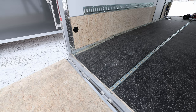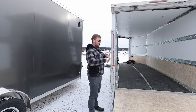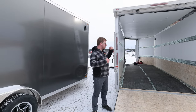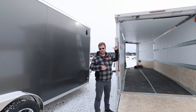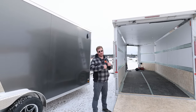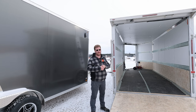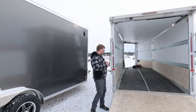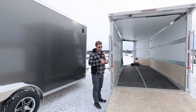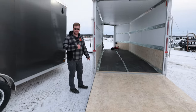I've done a no-show beaver tail — a 48-inch no-show beaver tail, so it's bringing that peak four feet inside the trailer, which is great for my side-by-side to give me extra height. This is a seven-foot tall, 84-inch trailer, and what that beaver tail does is instead of losing the three inches of header and having an 81-inch opening on the door, I now have 84 inches true on the door — 84 on the door opening and 84 inside to load what I need. Upgraded the frame and upgraded the ramp just the same as the other trailer — extra hinge, extra two uprights — because I'm loading a heavier side-by-side and a tractor. I also added an extra set of tail lights and the reverse lights.